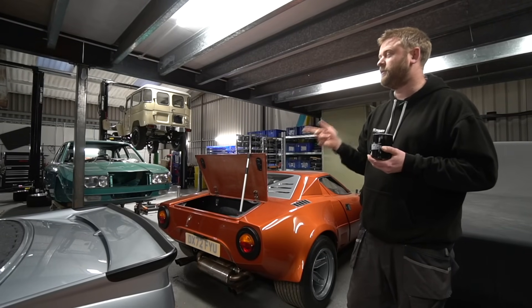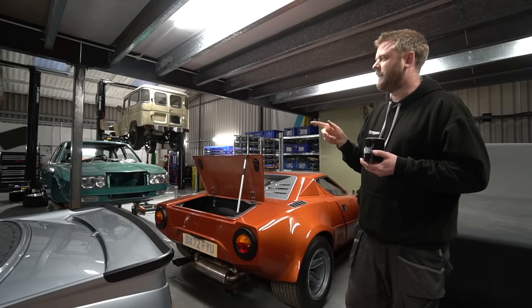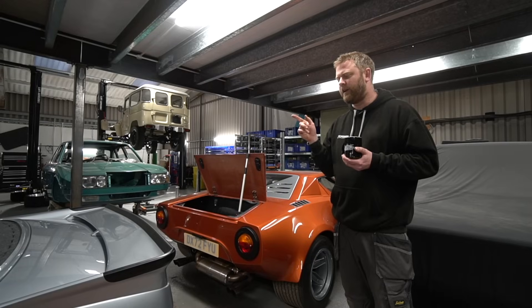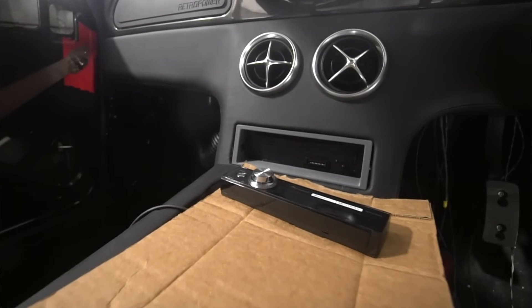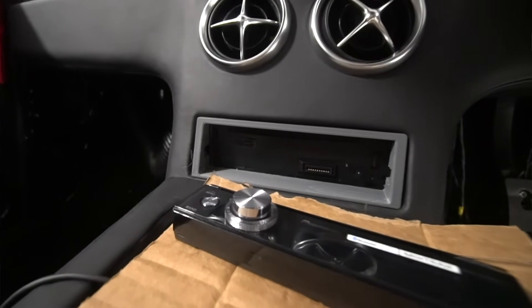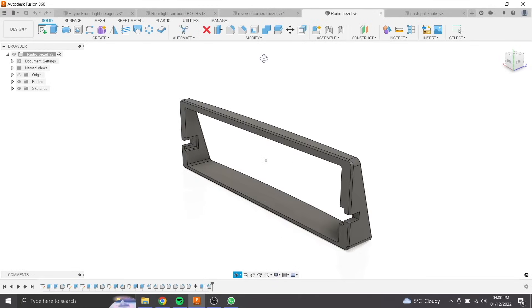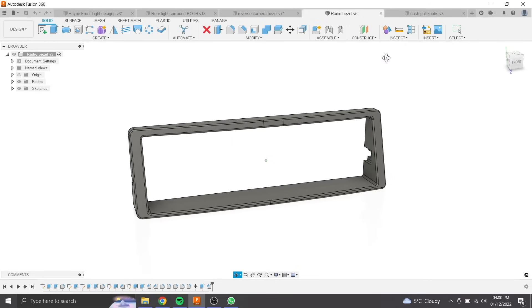Dean's collected all of the interior panels that I was doing layout plans for last week, so he's making a start on those now. George has also just done a bezel for the radio. Where the radio sits in the console it's on a sloping section, and to make a standard DIN size head unit look more tailored, we're replacing the plastic bezel with a custom piece designed to follow the shape of the console - so it looks like a proper installation rather than an off-the-shelf head unit dropped into a slot. He's 3D printed a trial for that.